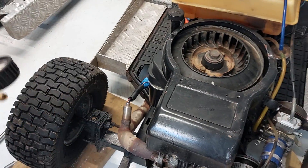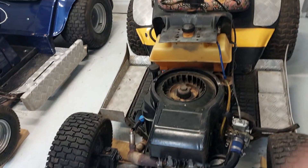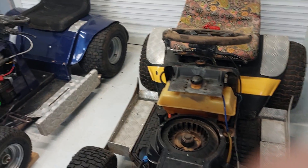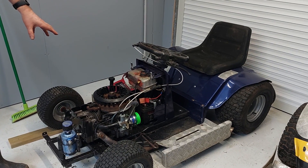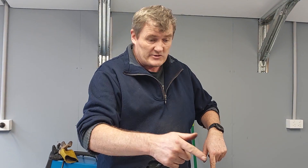We've now tested both of these engines. The 31CI is in not bad condition, but I think I'll probably pull the head off it and show you what's inside. My Class 1 engine is going to need some work — I've just made myself a whole lot of work. Compression tests are not that wonderful on these because they have anti-compression levers and cams that don't allow full compression when you're cranking, so this is the best way to test it. You can do a compression test — it gives you an overall guide. The other good thing with doing these leak tests is if you listen to the inlet manifold and the exhaust manifold, you can also hear if the valves are leaking. On both these engines the valves are not leaking — I couldn't hear any air coming out, and when I blanked off the PCV, there was no more air coming out. So I'm happy with the way the heads are.